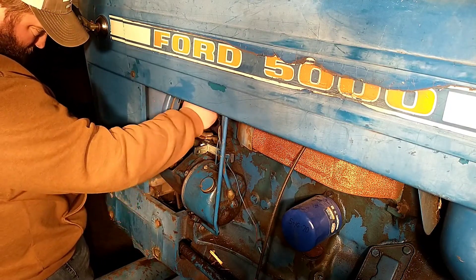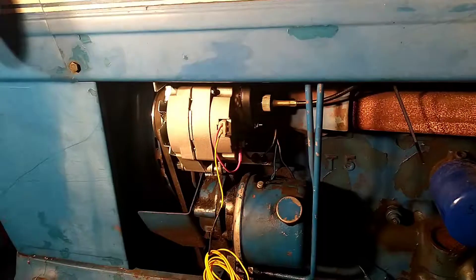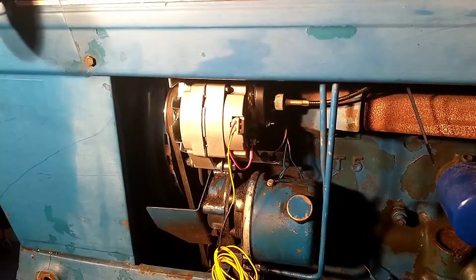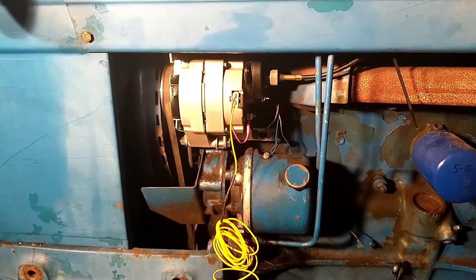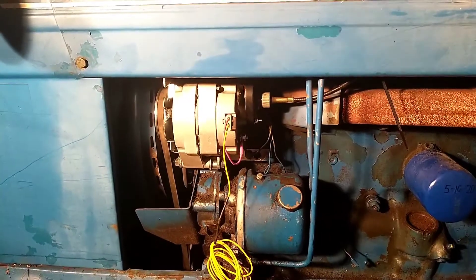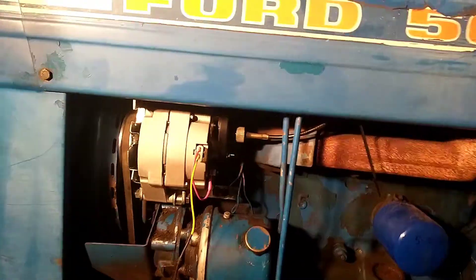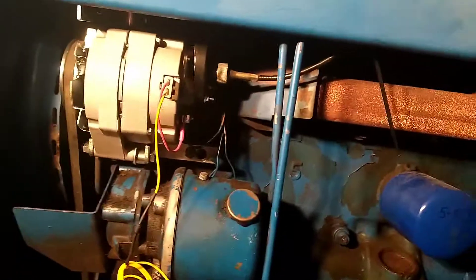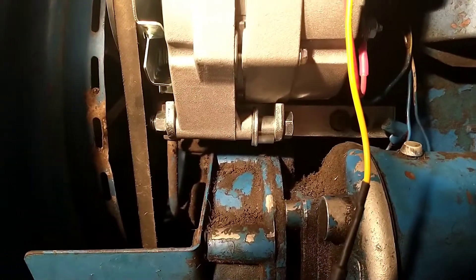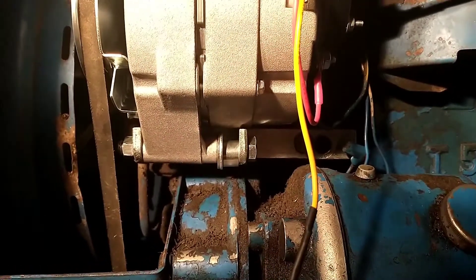Just the instructions are lacking. I've got the alternator on there now — I kind of skipped forward here because the kit brackets didn't quite fit the way I expected them to, and not really quite the way the instructions said either. Not too big a deal; it just took a few times on and off to get everything figured out. What I ended up doing is using the diesel tension bracket. I did wind up using a supplied spacer down there and threw a couple washers in to push it forward. I'd like to have it even a little bit farther forward but the bracket doesn't allow that, so we're going to see how it goes.